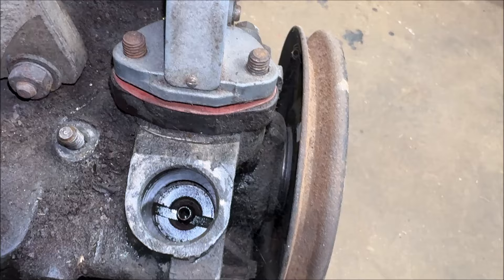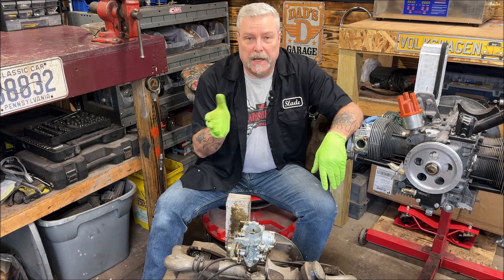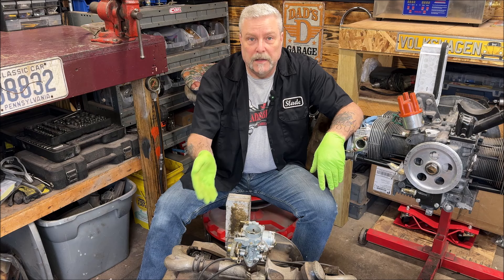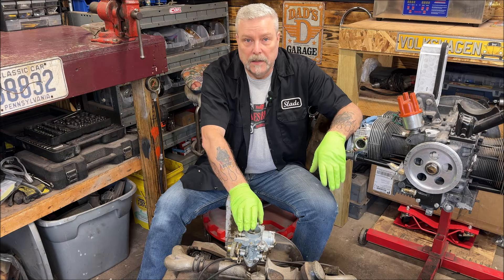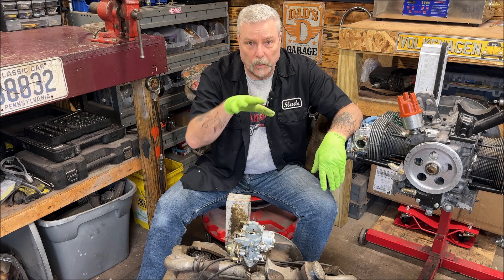The reason I showed that is because I've had people on the group send emails and private messages saying their rotor is pointed completely the opposite direction and they panic. However, if somebody put the distributor drive gear in 180 degrees out, then your rotor is going to be 180 out. And it's okay — that just means you rotate your wires on your cap so number one is coming in at a different position. So if the distributor gear was put back in 180 out, your rotor will just be in a different position.